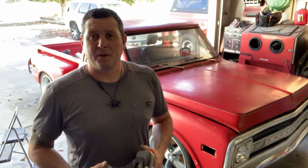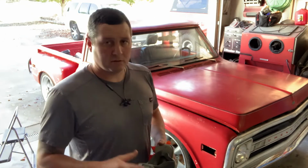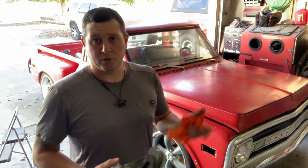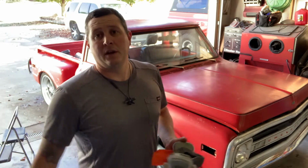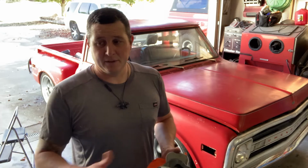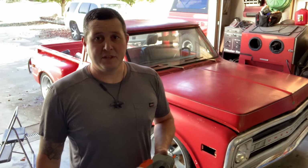Now that it's all prepped and ready to go, mask time. I'm mixing it 8-to-1. I'm gonna use a little paint tray for touch-up brushes and stuff like that. And definitely wear some gloves, get your good mask. I'm just gonna go from the top, middle, work my way down the sides to the hood, and we'll see. I've got a pretty good idea what it's gonna look like just from the wipe, the prep all, making it wet. And if it's half as deep as that, I'm gonna be thrilled.